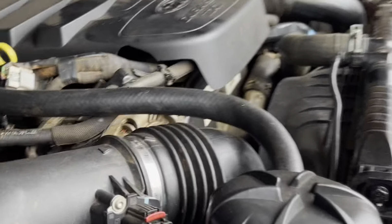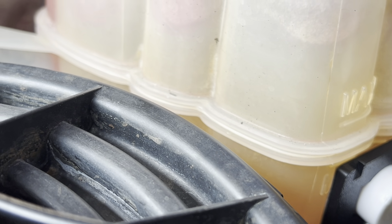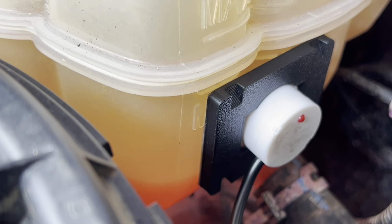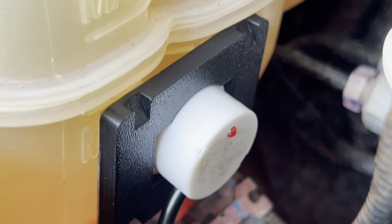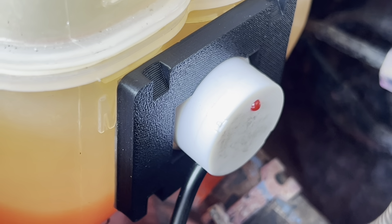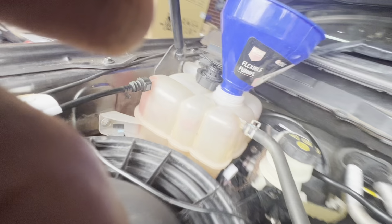So I stop the drain. That's the one that I left. But anyway, it will alarm anyway. So that's all the way below the circumference, or below that white, below that sensor. Then the light is off. So you can see the light is off. So it means the sensor sends a signal to the dashboard or to the gauge that it's losing coolant or low level or below the standard level. So it works. So it will keep alarming.